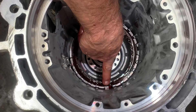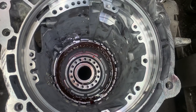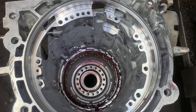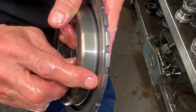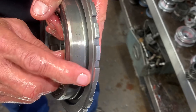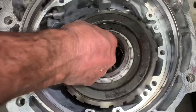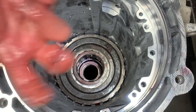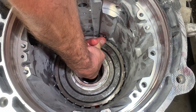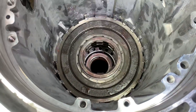You look at your clutch, you can see it's setting down just a little bit below that ledge right there. And what that's going to do — see that lip right there? It's going to take up that gap between that clutch and right here, it's going to sit down below that. So what you can do is set this back down in here just like this with all your planetary gear out and stuff. Now you can take these two fingers and go up there and feel that clearance.